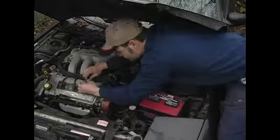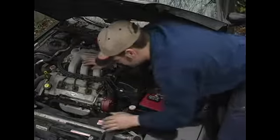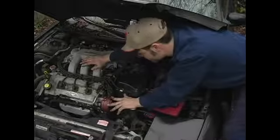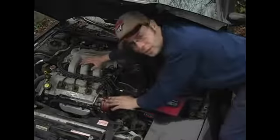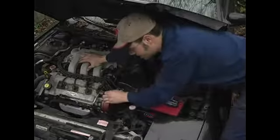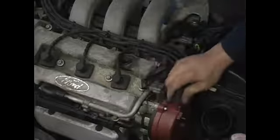The PCV valve should just pop out of its hole, like so. Undo a possible connector or two, and fold it out of the way. The appropriate method for removal of a spark plug wire connector is to twist and pull. Otherwise, a good wire can be damaged during service and need to be replaced. You give the cable a twist and a pull.